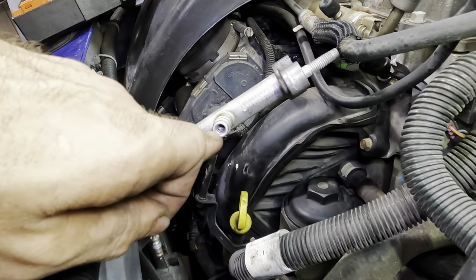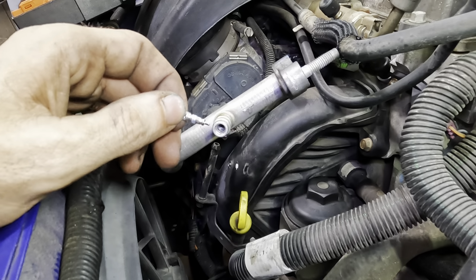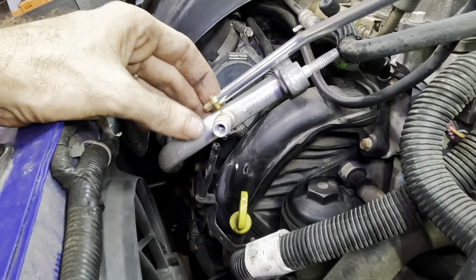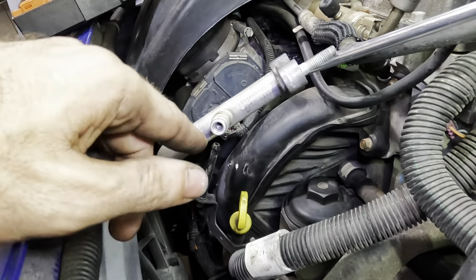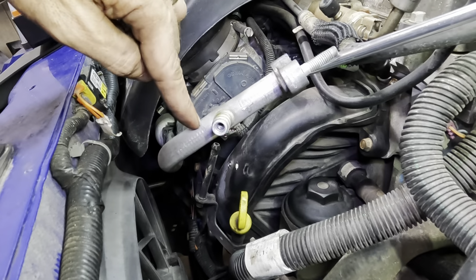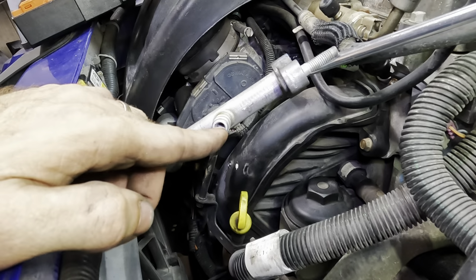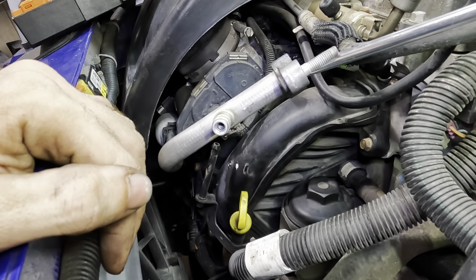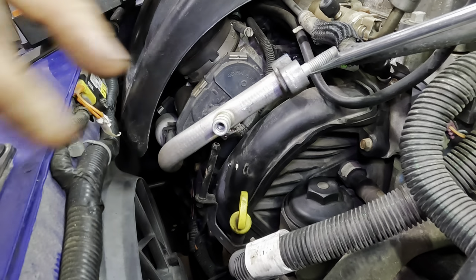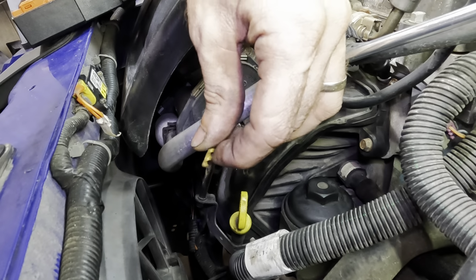Next up, I'm just gonna try to go in there with a drill bit, see if I can drill that outer diameter away, maybe flush it out with some air, and then we'll see if it's gonna work or not. I've got an air line here and it will extend in past the valve area. So whatever drill shavings I create, I can blow in some air from this point and it should backflow and flush out any contaminants that might end up inside. It's risky, but the downside is I'll have to replace the line. I've got to replace it anyway, so I'm trying to save it. We will see. I don't know if it's gonna work or not. It might. Let's try it out.